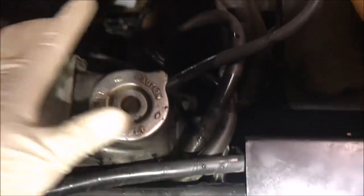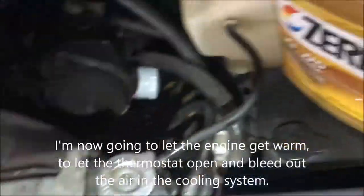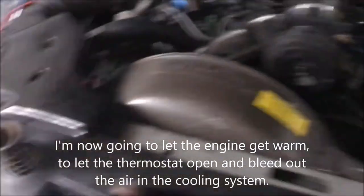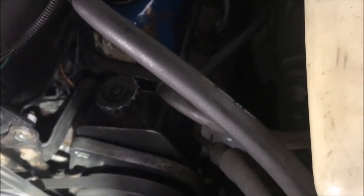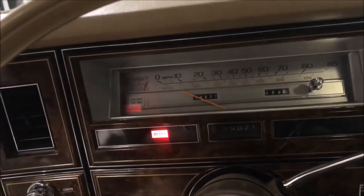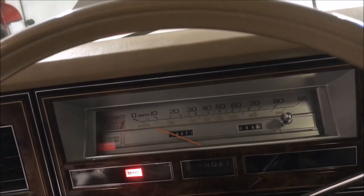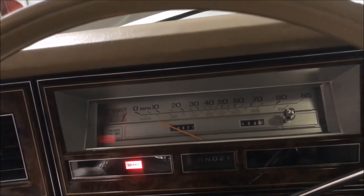I'm going to leave the coolant cap on but not tight so the excess air can bleed out. Seems to be running smooth. Let's check that crank seal — I don't see any oil coming out of there. Let's give the engine a couple of revs. Yeah, it definitely feels like the ignition timing is too advanced — I'll have to take care of that. The factory setting is like 14 degrees but the valve timing is retarded with the advanced keyway.